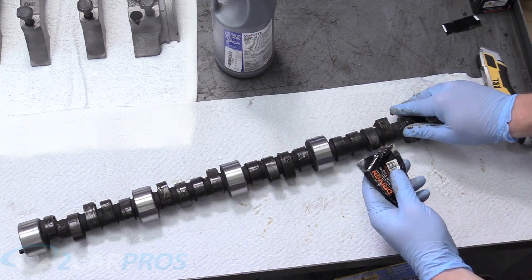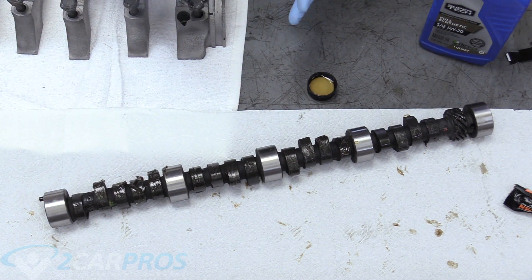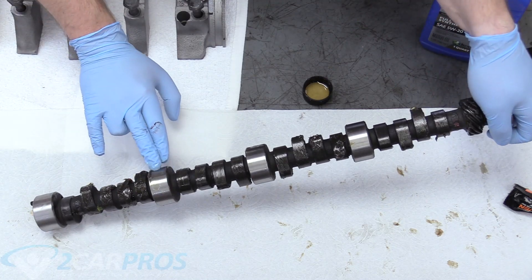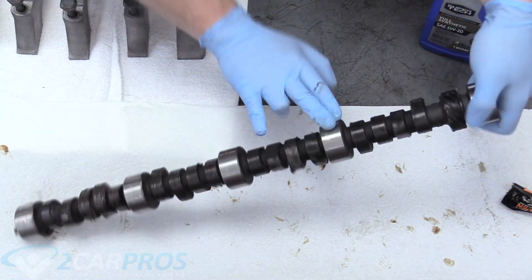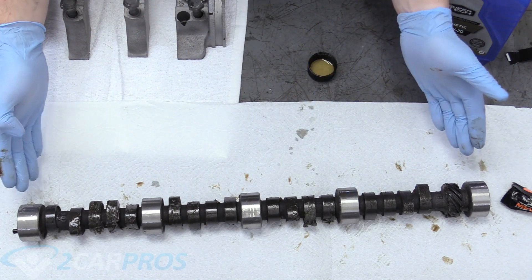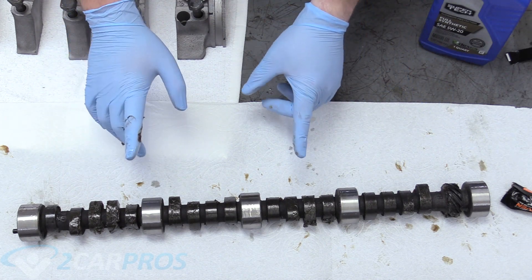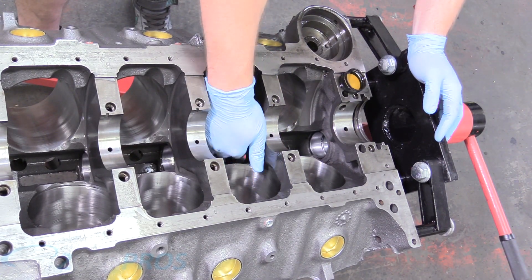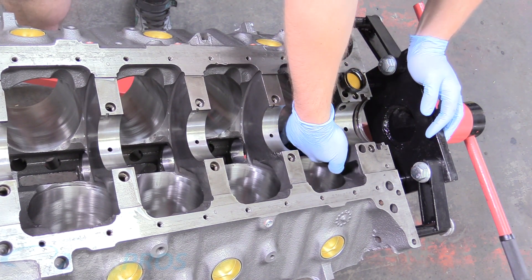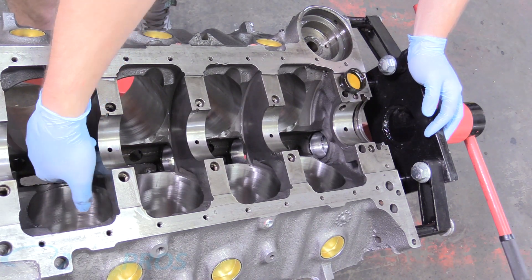I still have quite a bit of assembly lube left. I've got some in this cap here and we're going to put it on these five main journal bearings — dab it on our fingertips and go around on each one for a nice film for assembly. Each journal now has a nice film of assembly lube and each lobe has its assembly lube. Now we need to turn our attention to the engine and put some assembly lube on the cam bearings inside, because the camshaft can't be dry when assembling — the surfaces will eat each other.